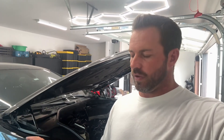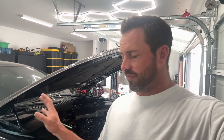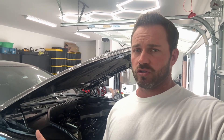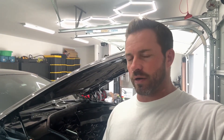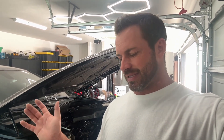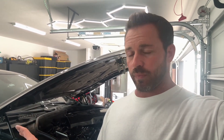So that's where we're at with the car right now — the dyno baseline is done. A point I wanted to highlight: after the dyno session and me not being able to do it in full stock, this car — the 640i — comes with a high-output version of the N55. They advertise it at 315 horsepower, and the MPPK is advertised at 326 horsepower, so it's only about a 10 horsepower crank difference. So when we got 300 horsepower on the dyno, it's pretty close to what this car would be making stock. I don't think we've skewed the data too far.